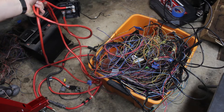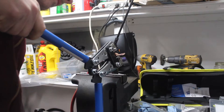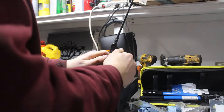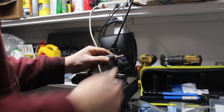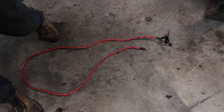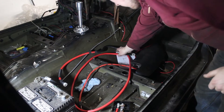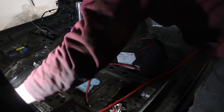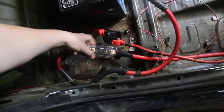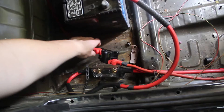Next, I had to make the power distribution system. I had cut out the battery wires but these were still good to reuse. I got a special crimper to install some new eyelets with heat shrink tubing applied after. This system really isn't that complex — I have a main power switch that switches all the power, then the key is used to trigger a relay that allows the power to go to the fuse box. The alternator and starter are on their own cable that goes back to the battery, mostly so the car can't power itself if the switch is off. This cable has its own 250 amp fuse, separate from the fuse box. I also added a thermal resettable breaker to the cable that supplies everything else, to make sure any short before the fuse box will still shut the car down.